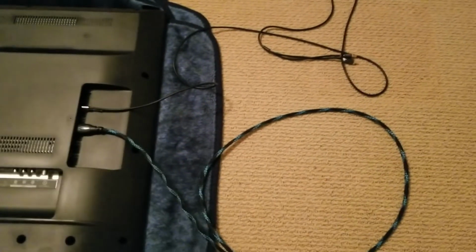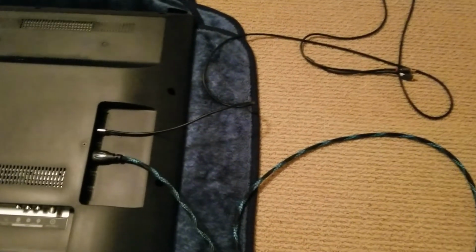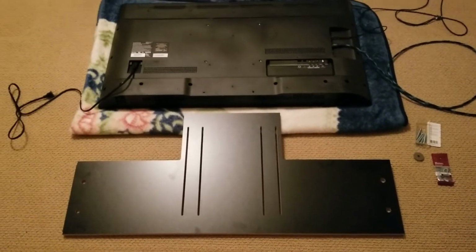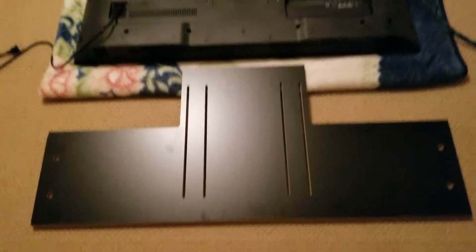And I saw in one of the Game Room Solutions videos on the audio that instead of having your computer plug in directly to the amp, you can get a hum on the audio that way. It's better to plug your computer into the TV and then send the sound from the TV to the amp, and you might not get a hum as much. And you'll see it's got the audio out here from the TV, and then these two will plug into the amp itself.